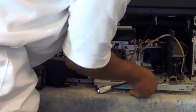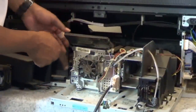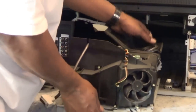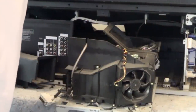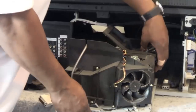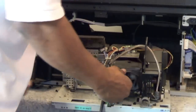I'm going to show you the lens when I pull it out. Now look at this fan here — that fan is for the lamp. What happens is when all that dirt and dust gets on there, it not only slows the RPMs of the fan down, but there's also not as much air coming through. This is where we pull our lamp out — it goes right in here. That is the actual fan for the lamp, and it is totally unacceptable.